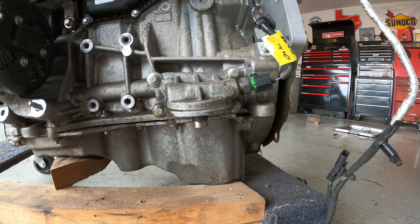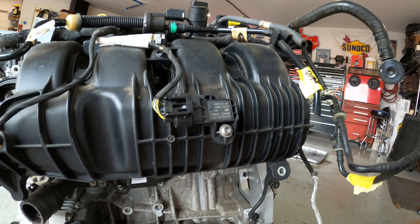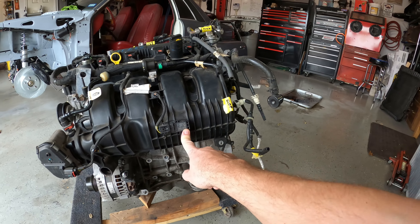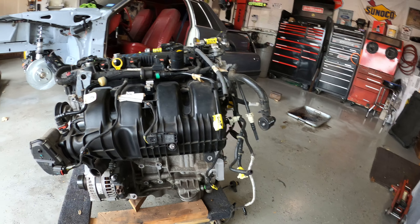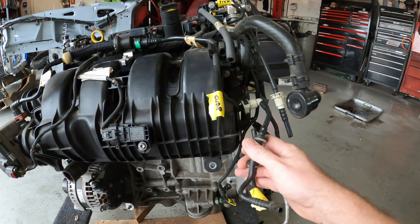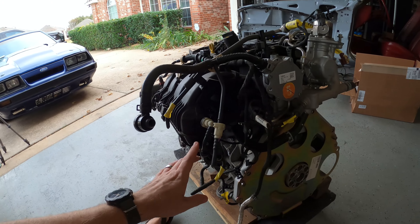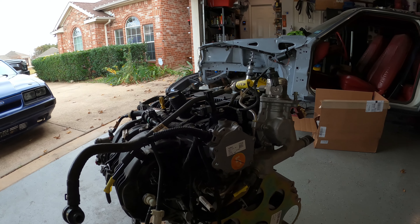Down here is the oil filter, and screwed to its side is an oil pressure sender. There's also what appears to be an intake air temperature sensor or boost pressure sensor - there will be one pre-turbo and one post-turbo. On the back of the intake are vacuum lines with check valves - these are necessary on a boosted motor. Also on the back is a cam-driven mechanical vacuum pump, since boosted motors don't produce consistent manifold vacuum.